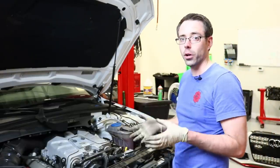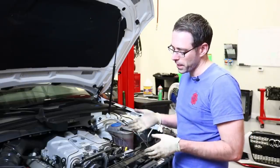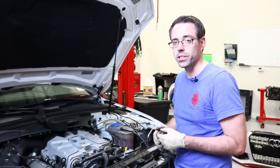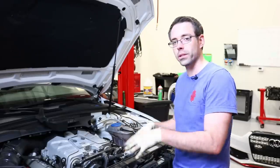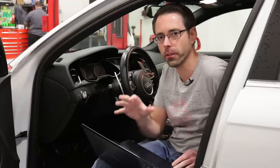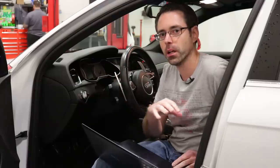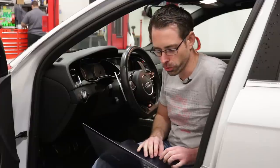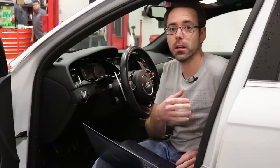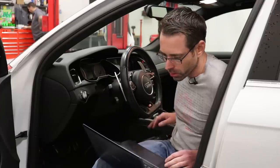Now we're going to torque the crank bolts with the belts on, which will help hold the pulley in place. If you don't have a crank hold tool, the belt tension is your best bet. The torque spec from Unitronic is 20 Newton meters and a quarter turn, which is included in their instructions. We're going to torque everything down and reassemble the car. We're now the next day — we had some technical difficulties with drivers so we had to scrap tuning that evening. We're using Unitronic's dealer tool to flash the vehicle to stage three. If you're doing it at home you can flash with the Unit Connect cable — we have a complete DIY video showing how to do that.